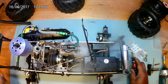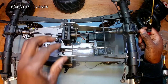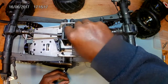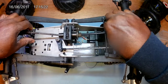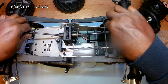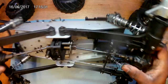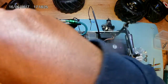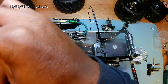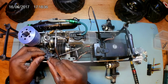The next little detail was to actually cut the other two servo horn pieces off, and also to sort out the brake. The brake always seems to be a bit binding, even though this is not really the correct brake disc for this car. I think it has a 2-disc system, and I think this one kind of binds a little bit too much. So you can see here I'm taking the servo horn back off, and magically you will see two of the servo horn pieces have disappeared.